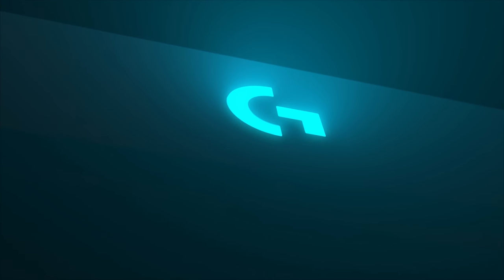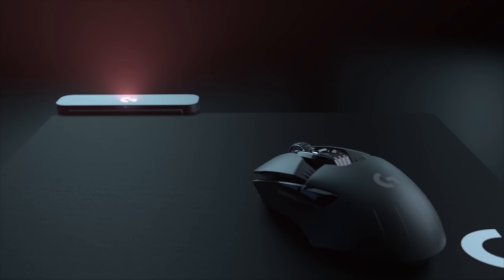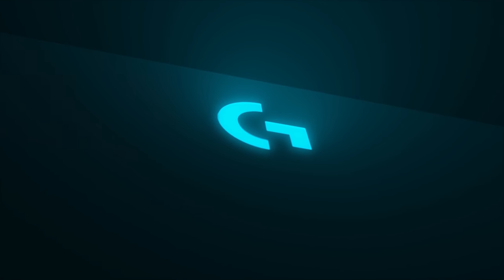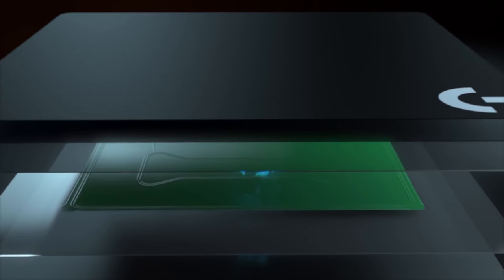For the basics on what this is doing: there's an oscillating EM field that charges one coil, which then induces current in other coils — that's the one between the mouse and the charging mat. It uses magnetic resonance, so there's a magnetic field from the primary coil that radiates equally in all directions. That primary coil is in the mat, and the field will be strongest at the center, losing power and efficiency toward the edges.